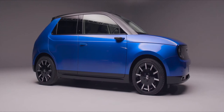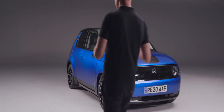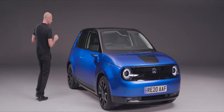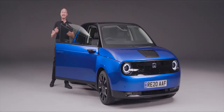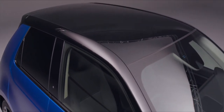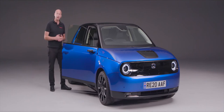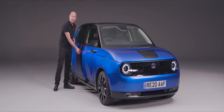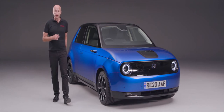The other way is without actually using the key fob at all. As I approach the car and get into the detection zone between the key and the car, the door handles will pop open. There's a little sensor underneath — just give it a moment and it will allow me to get in. To lock using the keyless system, there are three little ridges on top of the door handle; just apply a little pressure onto those and the car will recognize this and lock the door.